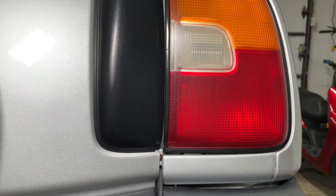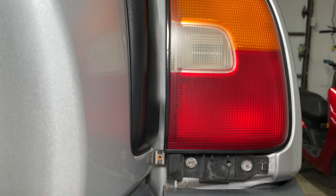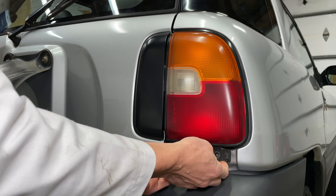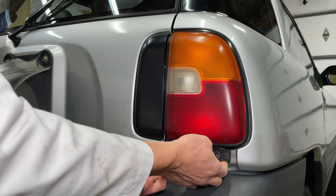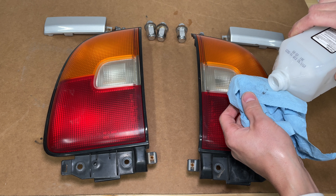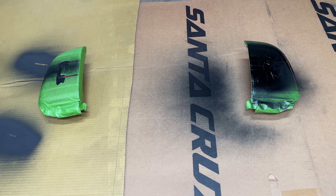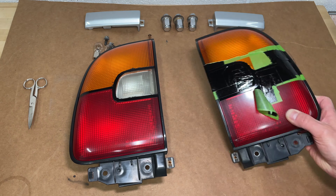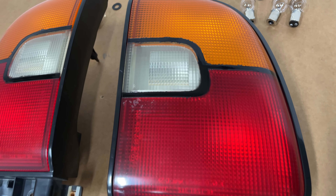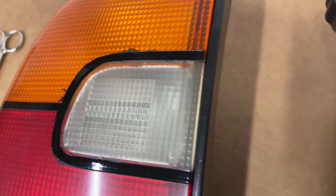On the right side of the car the wiring is the same. Let's start by grounding the low beam headlight. The red wire with a green stripe is the low beam ground from the switch — we don't need this wire. Match up the red wire with a yellow stripe for the high beam negative going to the switch. The right side headlights get their power from the red wire with a blue stripe. Connect the other two headlight wires to this one. The low beam has a brown connector and it's grounded directly to the body; the high beam negative wire is red with a yellow stripe connected to the headlight dimmer switch.